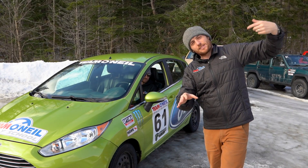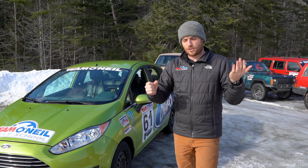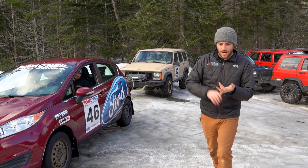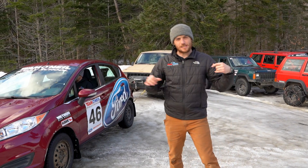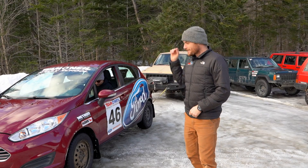With higher angle stuff and off-roading, it's always the uphill tires that spin. More commonly, any two-wheel drive is going to be like that unless it has a limited slip differential or traction control. This car has traction control, ABS, and stability control still hooked up. We're going to spin the tires and see what happens.